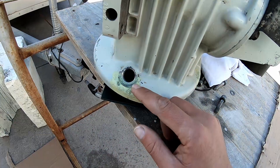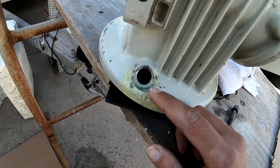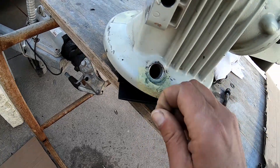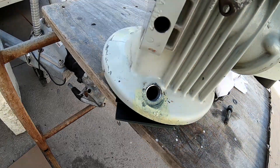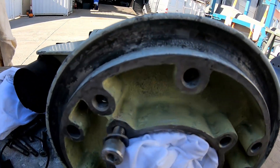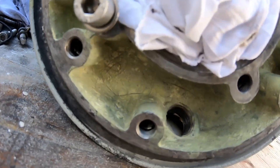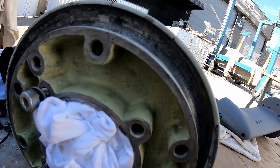I took the water inlet for the engine out because I didn't like the plastic ones that were original with it. Again, a little bit of corrosion, so I've painted Duralac on here. Lots more Duralac painting - a bit of wire brushing, lots of wire brushing, and Duralac painting - making it all protected.